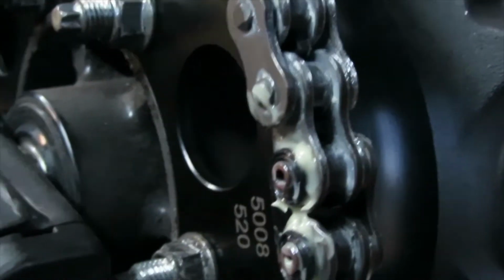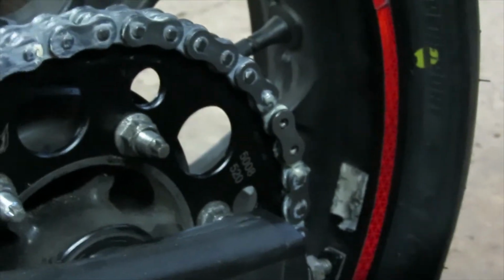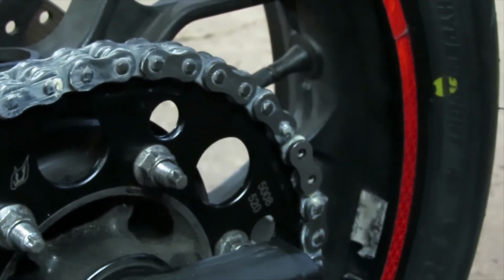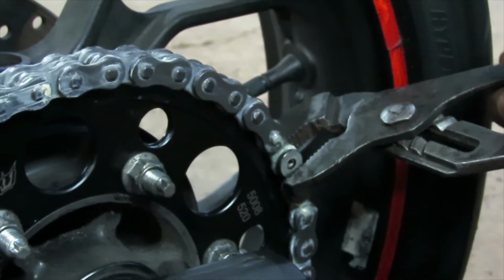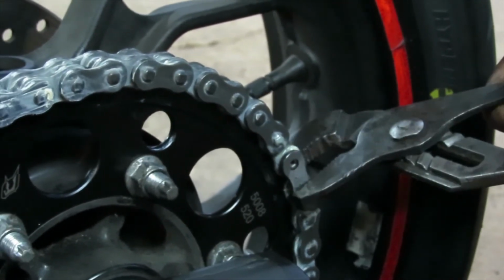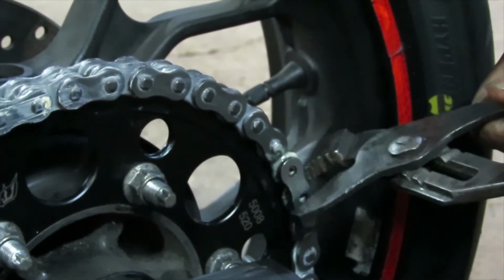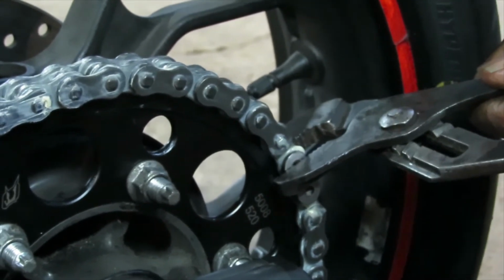We're going to put it on there, and then we're going to press it in using the tool that's right there. Okay, once you have the link plate on there, you can go ahead and grab a set of pliers, and you want to make sure that the plate guard is already on those rivet pins before we use the tool to flange out the rivet and make it permanent. I want to just give it a good press, make sure they're on there good.